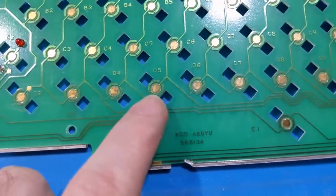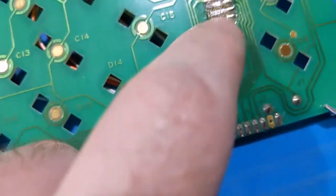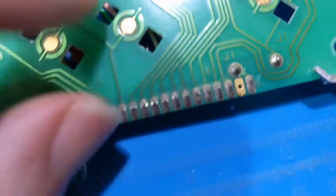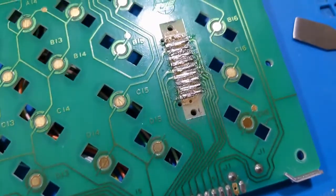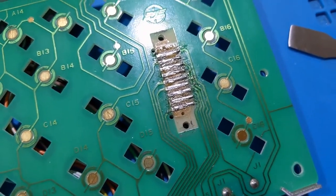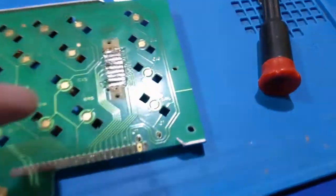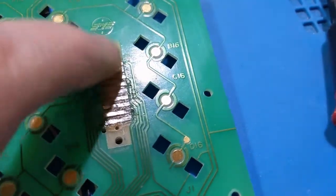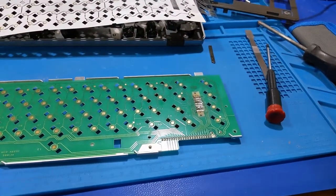These two are together, so I know these are all together. So really, the connection point here is just not making good contact. So, all right, well, I need to clean that up and fix that, because that's not gonna work. So the problem is someone screwed up this board. The board's junk. Because look, it's delaminating. Yeah, I can't. That's a problem. That's why we're having this issue.